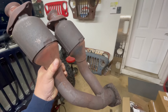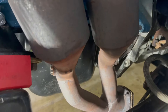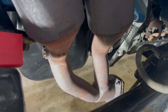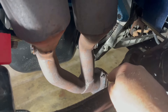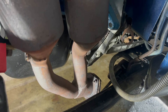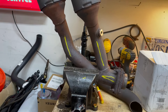Now that I've got that cut off, I'm going to offer this up and see how much I really need to cut out of it, so let's get this thing mocked up in place and see what it's going to take to get it straight. I'm going to take a section out of this pipe right there and a section out right here, and cut that flange off too. I've got a piece of pipe that I think will fit perfectly once I get it straight.